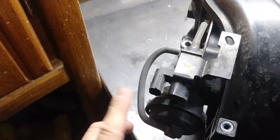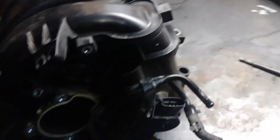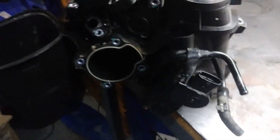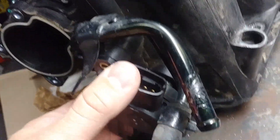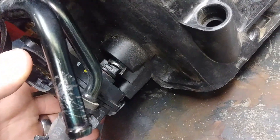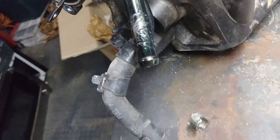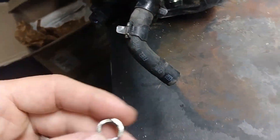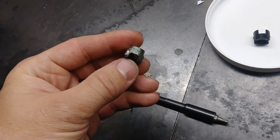The reason I think it didn't fix my code is on the other side you have a vacuum actuator. When I was lifting that all the way with my hand, it was kind of getting stuck. You guys can watch that in my first video. I'm gonna pull this out so you can see how it looks — see how that coupler just drops out like that. That's what it did when I pulled mine out, and this is the one I Jimmy-rigged, made out of metal.